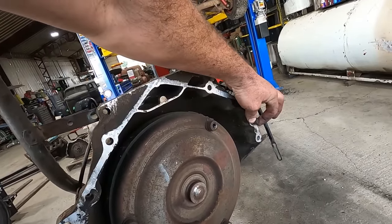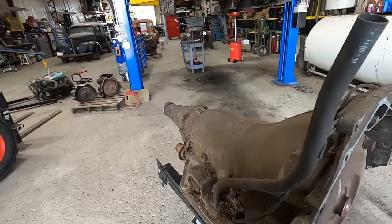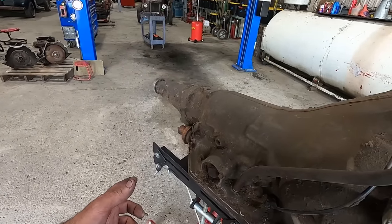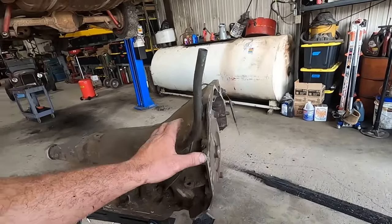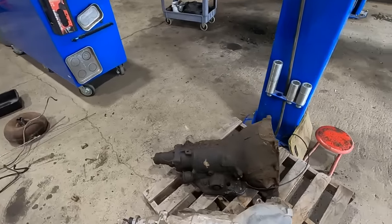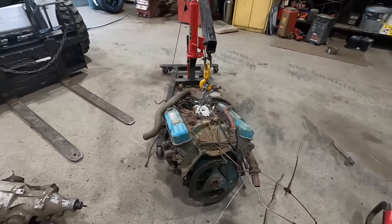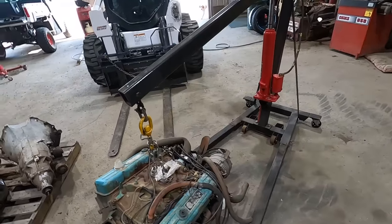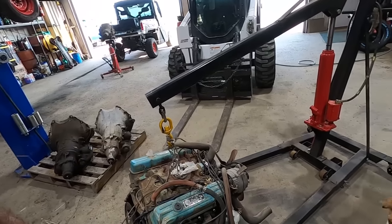We gotta knock this dowel out of there before we get it in there. And then we gotta put a different kickdown on there. And I learned from the last time I swapped kickdown cables that we shouldn't have to pull the pan. We probably should pressure wash it, but we won't. This is a Turbo 350C, so it's got a lockup torque converter. So those can go back on the shelf. Make sure we label what the heck they were. And this thing can go out in the scrap pile because I think she's stuck. And I don't plan on doing any 300 Buick stuff. Do you, Duff? No. Well, Mojo's got a small block all apart here, so let's see what he's got going on.